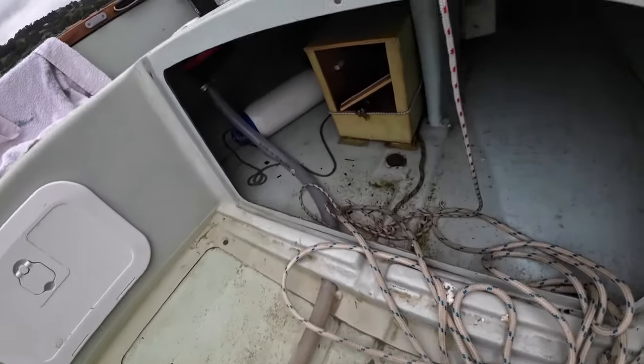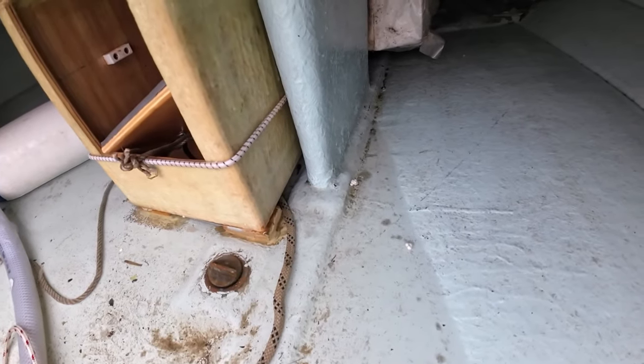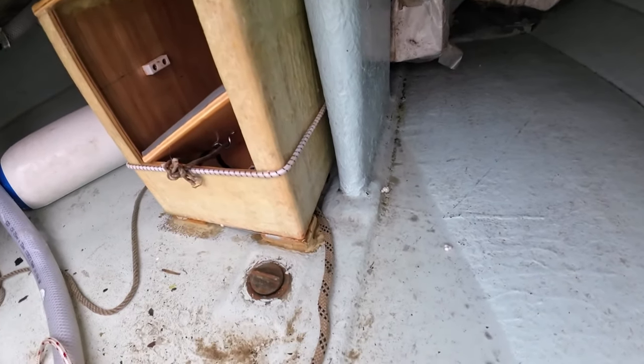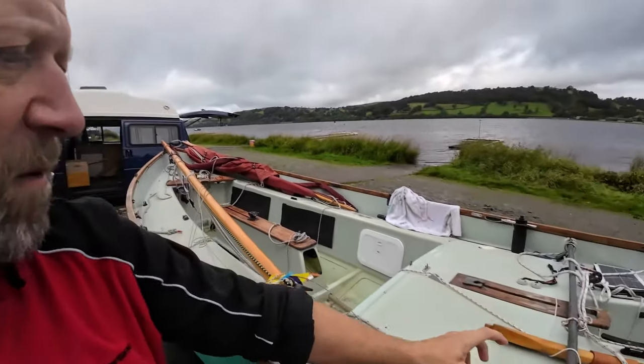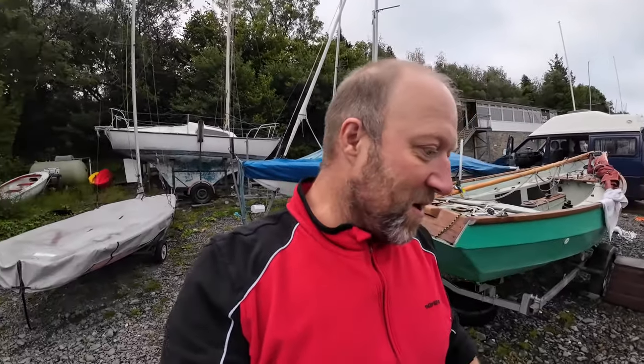At the front of that rudder stop there are two little screws sticking out — they used to stick out a lot more because I put some silicone on them. I've had a few niggly problems with the rudder getting it in and out recently. I wonder if the bottom brass plate has got a bit knocked and gone loose — and because it's loose it's harder to get the rudder in, so you knock it more. I've seen on another lugger the same thing where the screws just come through. All we need to do is fiberglass over those.